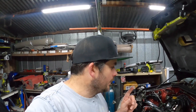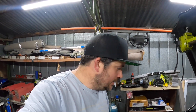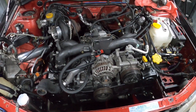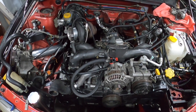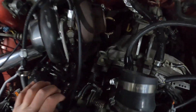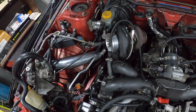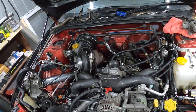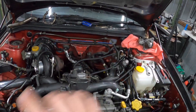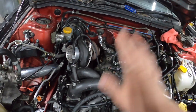All right guys, so I got most of it done. I did get called back inside to put the little one down again because he woke up. So I got about 45 minutes into it. I'm actually pretty lucky I got called away because a couple of people said to check that it hasn't been sucking in oil through the PCV valve and the breather, because they're all close to cylinder three. So check that first before you go pulling the engine. I'm also going to check the piping I pulled off because I don't actually have a catch can on that.